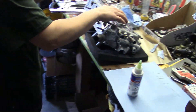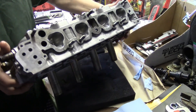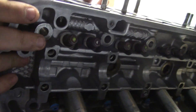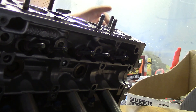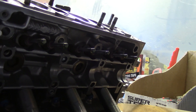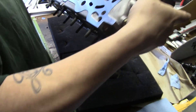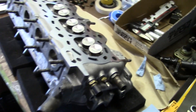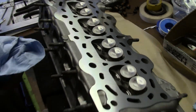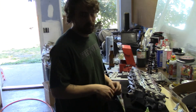Now turn the cylinder head up — you should be able to see each valve just push right through nice and easy, nothing fighting us. If you're rebuilding your stock cylinder head using OEM valves and one of them doesn't push through smoothly, that means you've got a bent valve stem and it's time to replace that valve. We'll repeat the same process on the exhaust side — everything's seated, no issues — then flip it back over and move on to installing the valve springs.